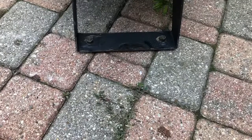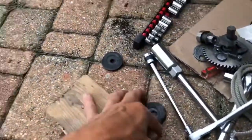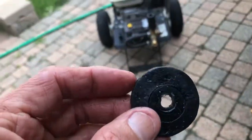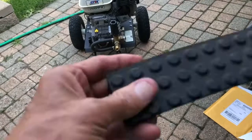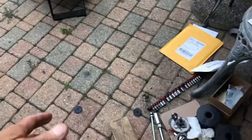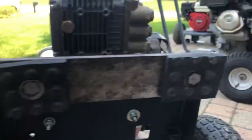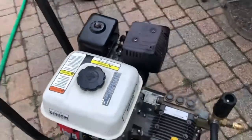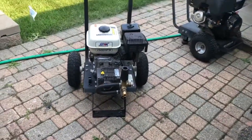I gotta get the rubber feet out of the basement. Okay, finished - ready to do a test. I didn't have the right kind of rubber feet. These are worn completely down. All I had was three-quarter inch and seven-eighths feet and it made the machine tip up in the air. So what I did was cut a couple squares out of this nice heavy rubber - it's compacted ground-up rubber we used to use at work to set satellite dishes on the roof because it didn't deteriorate. I cut a couple of square pieces with the dot side down and sunk the bolt up inside enough so the bolt isn't contacting the ground. Now it's got a nice soft action to it. Except for the badly worn-out wheel bearings on that side, which I'll address later - not critical. It's done.